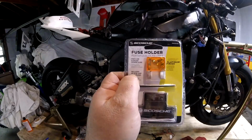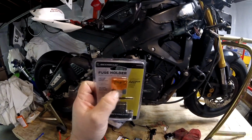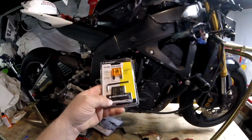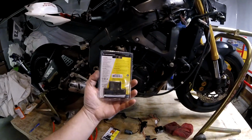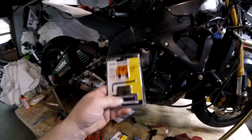I test the system on the 40 amperes, drive around with full batteries, make sure everything works, and then once I know everything's good and the system's trustworthy, I start draining the house batteries down real low. There are high amp draws because they start charging back up from being so low, and they start getting high currents across those cables, then I go to that 80 amp fuse.